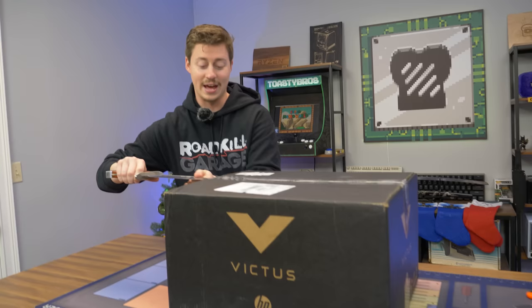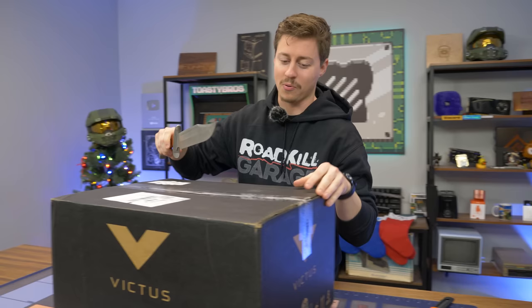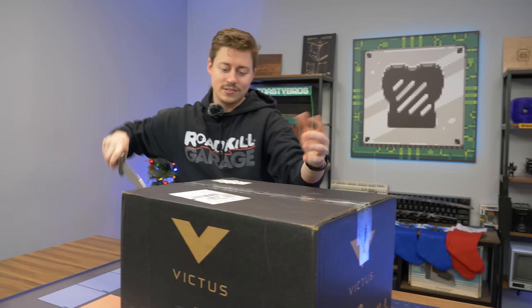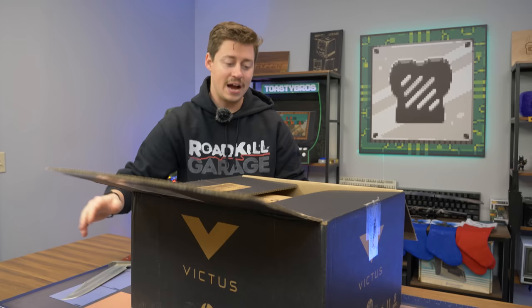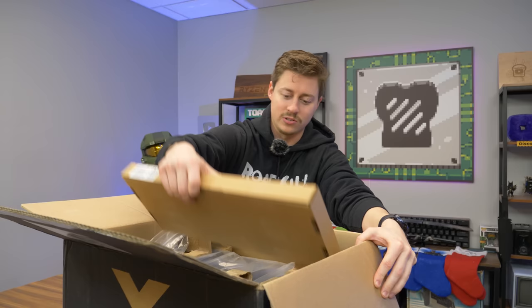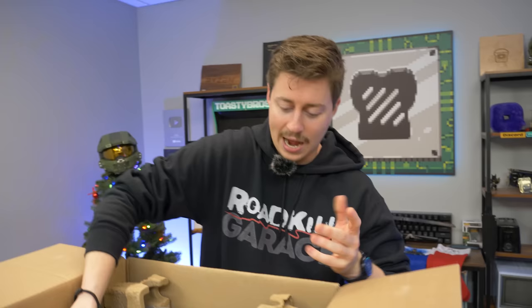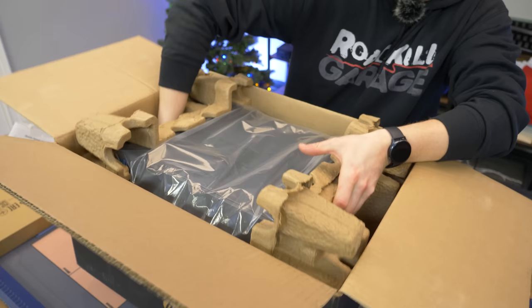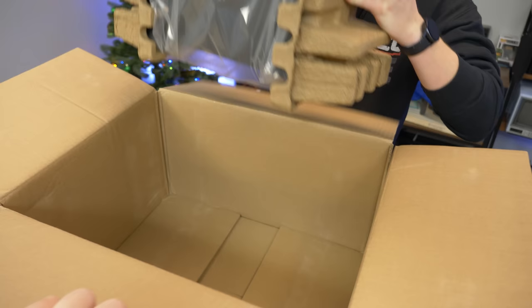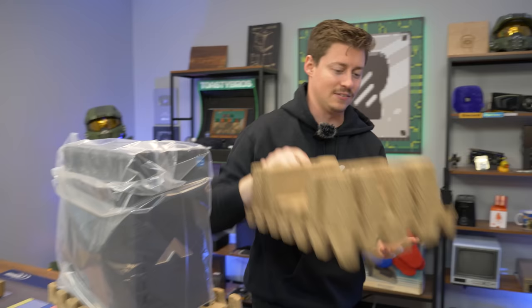So the 12100F, guys, is, I guess you could say, the successor to the 10100, which is one of our favorite processors. You can get those still for about 80 bucks at the time of filming this video. But obviously 12th gen's here. You got Gen 4 support. You have really nice DDR5 support. You have all kinds of new things that it supports, Windows 11 natively, that actually make it a really good processor. The 12100, you get about 10 to 15% more performance over the normal 10100F. Still 4 cores and 8 threads, but I think it's awesome. It's one of my favorite CPUs in the market. Extremely versatile, whether you're building one of the cheapest, just integrated graphics systems out there, or you're building a system with something like an RTX 3060 even, the 12100F just is a really good CPU for that.